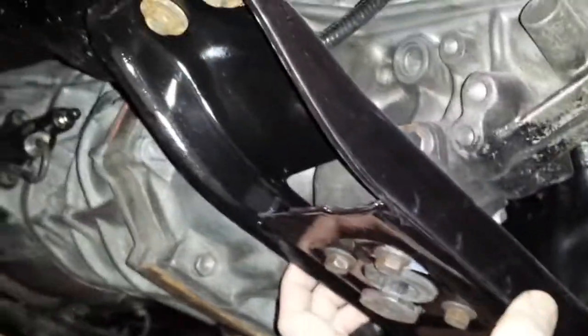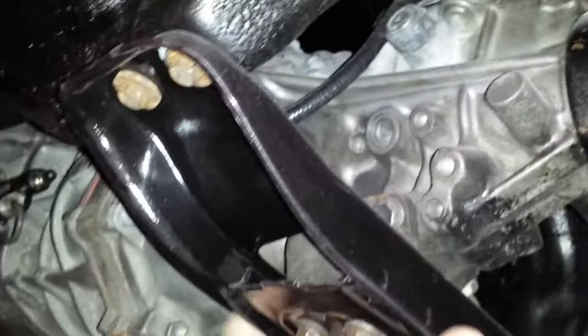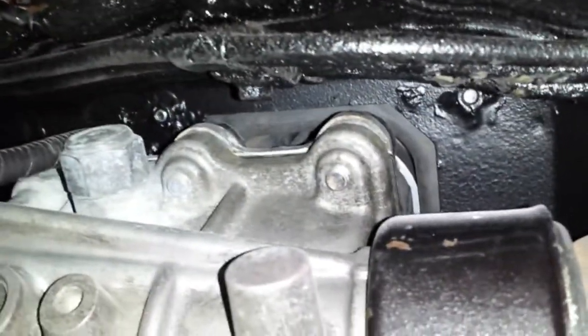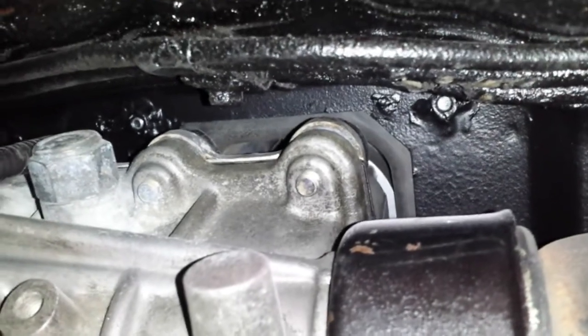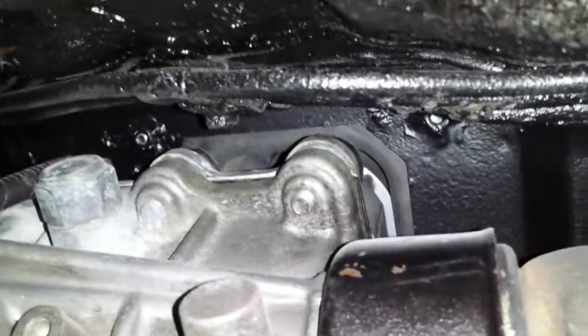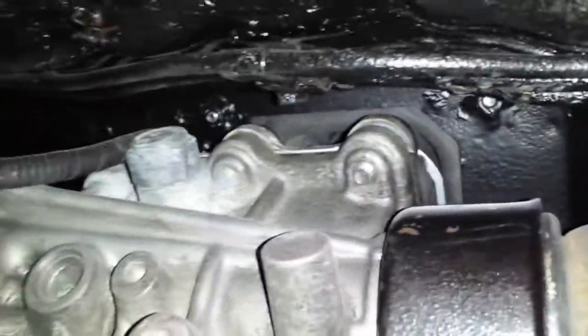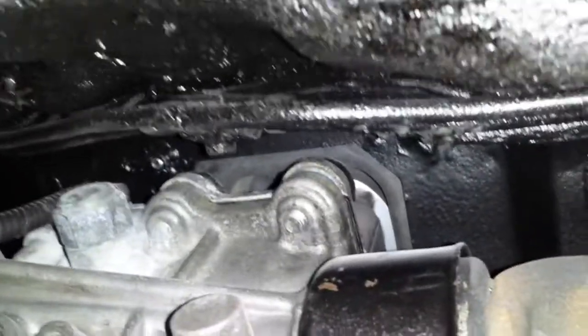This tranny doesn't go as far back as most people's R154s. This is actually the stock W58 5-speed Mark II crossmember without modification. It just worked. We did have to recut the hole and re-weld the nuts and everything, so it looks like factory up top. But still, it didn't move that far back. The stock center console is completely unmodified and doesn't interfere at all.